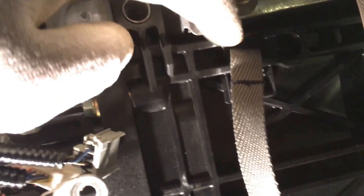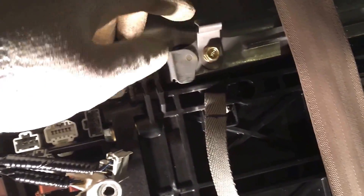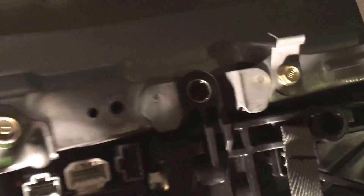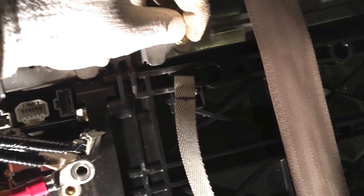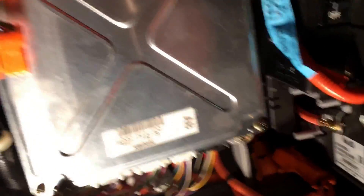One quick thing I missed — before you pull out the battery, you've got this little retention clip right here. What I did is I loosened it — this retention clip comes around and clips onto the plastic flange here. It's a safety thing in case the bolts vibrate out, or maybe for crash tests. That needs to be loosened — I spun it up and then tightened it. Also, there's one additional clip for this particular harness that clips at the bottom — so there are two different clip positions for this harness right here.